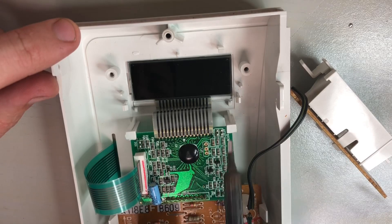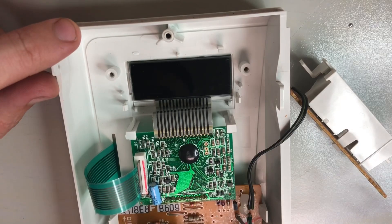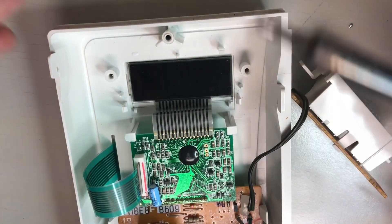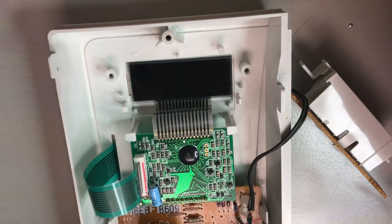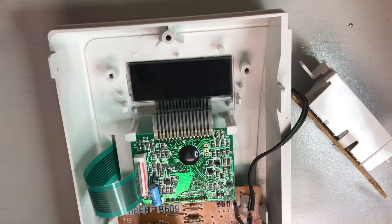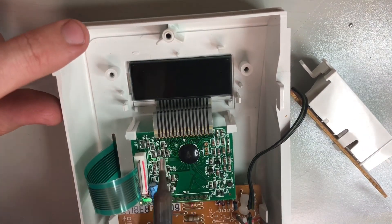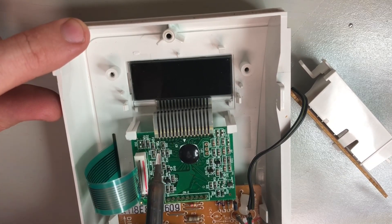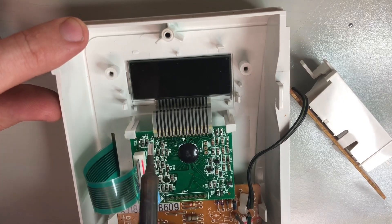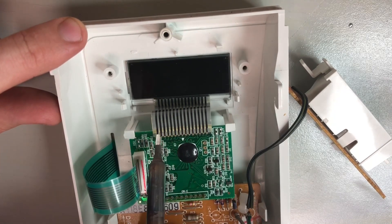I'm going to try not to disrupt any of the other circuitry. Things can be re-soldered but I'd rather not have to. I'll also get as much solder off the tip as possible. You want to drag along these carbon traces with a little pressure — if you go sideways you'll tear or melt the cable — so just some light touches along the traces.